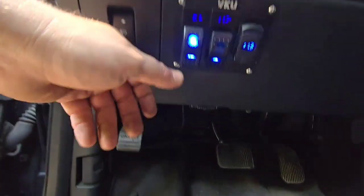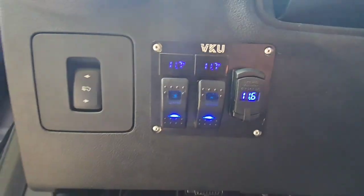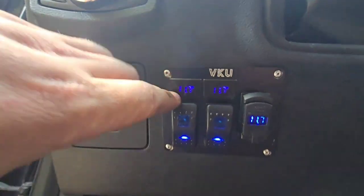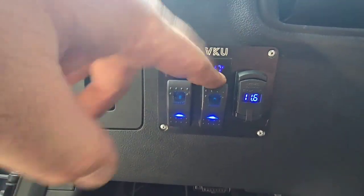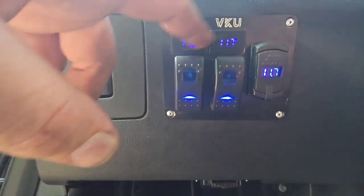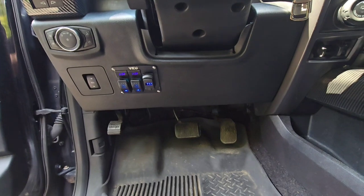We'll come around front and see that the light bar is on. Now, how I mounted the switch panel — I used rivets. It came with screws but I didn't really like them; I figured they'd probably rattle themselves out. I was going to use the second switch at a later date possibly for some under lights on the truck if I wanted them while driving, so I didn't want to buy just one and then have to go buy a second one later.